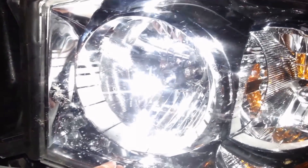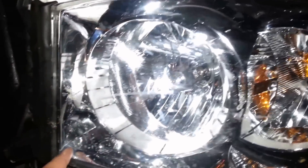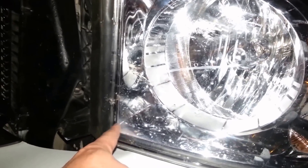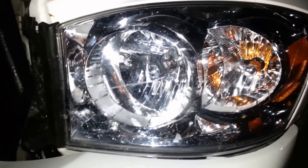But I learned a valuable lesson: if you've got a pool of water in there, don't lay the light on the bubble part and put a hair dryer on it. Stand it upright so all the water pools in one corner, shake out as much as you can, then just get the last drops in the corner and then put your dryer on there. So if it does leave hard water stains inside, they'll be down there and not across your light.